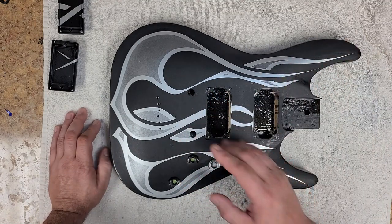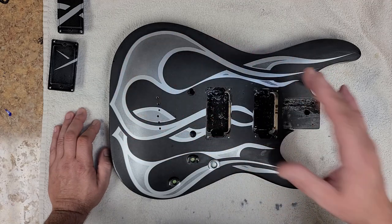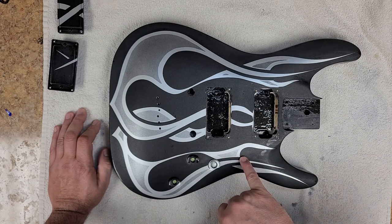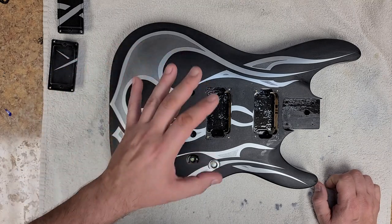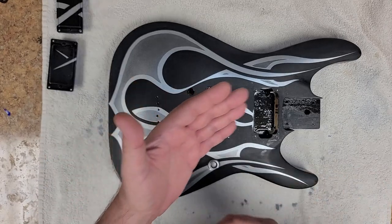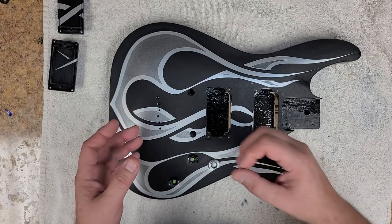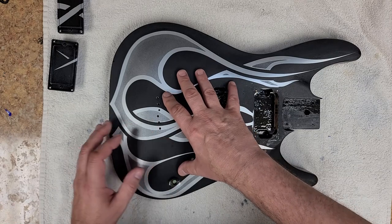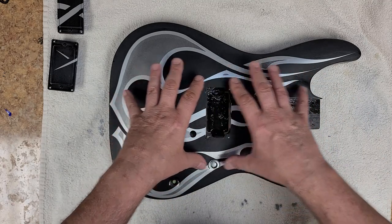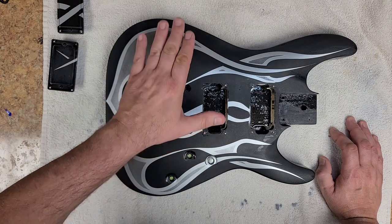This is one of the reasons I said to put clear coat on top of the black diamond metallic before doing any striping. If you make a mistake or get a little overspray through — there's a little point over here that's not supposed to be there — when you overlap fine-line tape going different directions you can get a small gap, which is what happened. But having the clear coat on top of the black diamond makes it really easy to scrape that off without disturbing the base coat underneath. That works out really well.